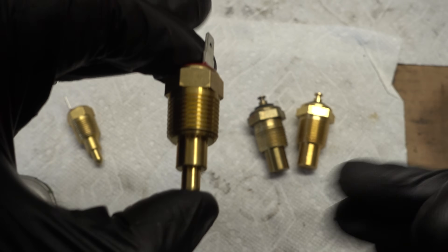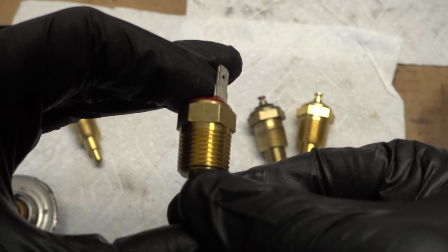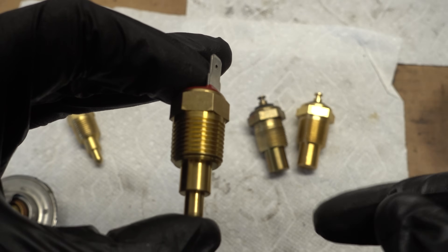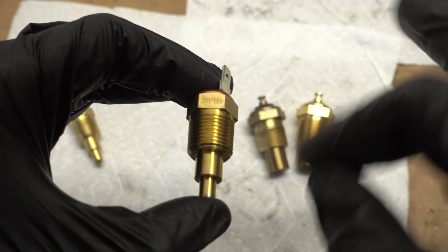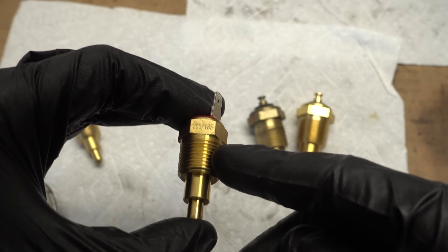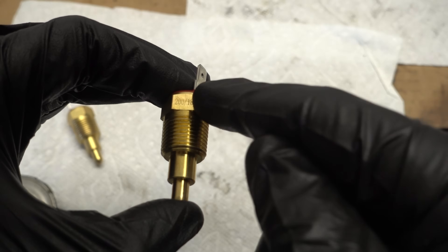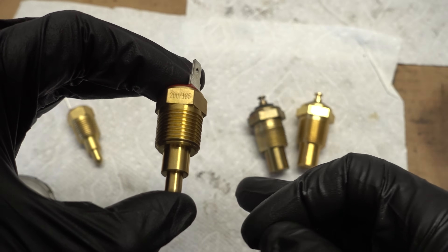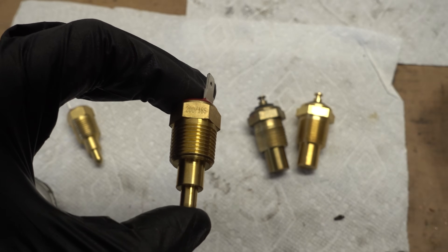The thermostat should still be fully open but the temperature will be more under control. This isn't necessarily ideal — I'd like to have it turn off at maybe 185 degrees. But this range should keep everything from overheating and should keep the fans from just being on all the time. What it might do is cycle the fans on and off more frequently because that low end is a little bit high for this thermostat, but I'd rather have that than have the fans simply run all the time.